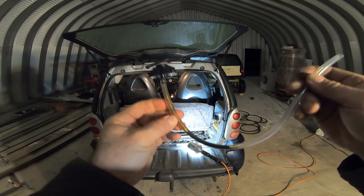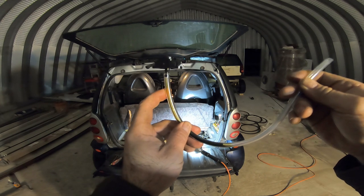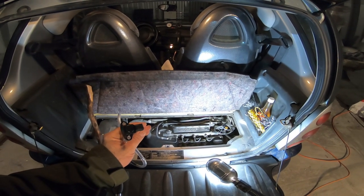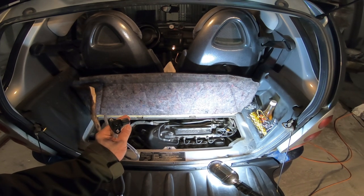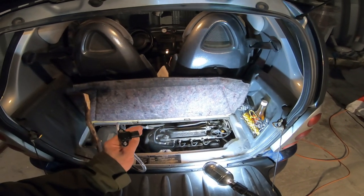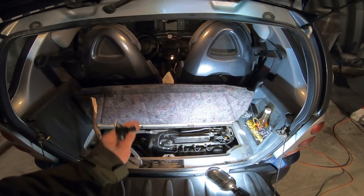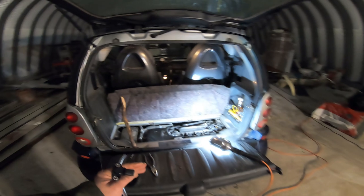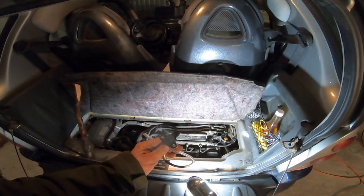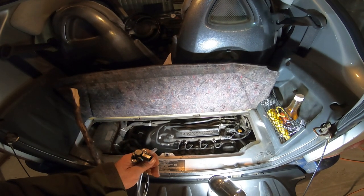If this is going on with your car — and I suspect it's going on with the large majority of Smarts out there — this car did start getting bad. It would run really good at highway speed or when you really gave it, but mid-range, anything from around 1200 RPM to 2100 RPM, it would stutter and misfire. You wouldn't necessarily notice it except as a hesitation before I put the straight pipe on, but now I can actually hear it misfiring. This MAP sensor plays a big role in how decent the engine runs.